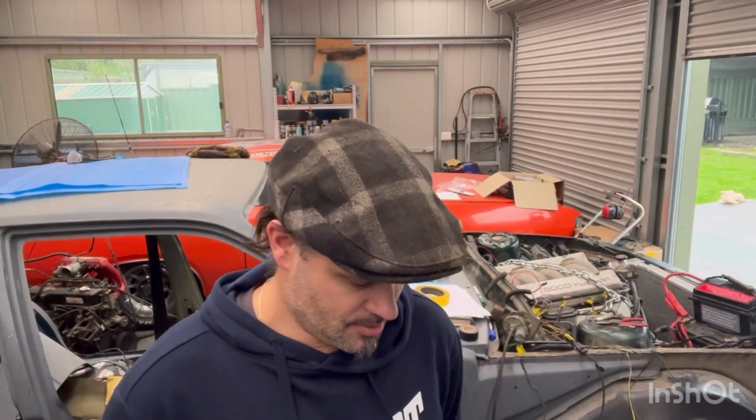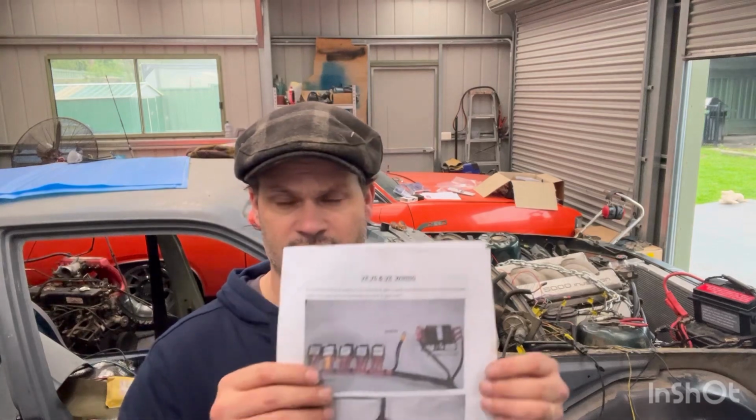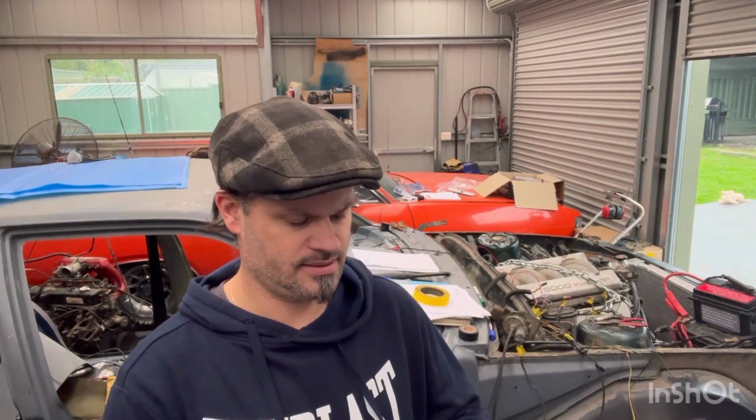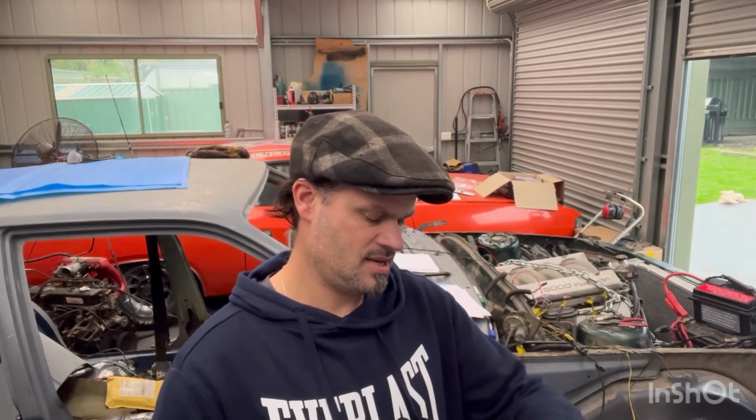I don't know, but yeah, if you get this kit and you get these 1, 2, 3 pages of instructions, the only thing that helps you is finding out what you want to go to those wires, and then there's nothing else. There's nowhere in here stating that you need to use parts of both old harnesses. Nothing. You have to work all that out for yourself. So if you're planning on contemplating this conversion, don't throw away your old looms, because you will need them, and a fair bit of them too.